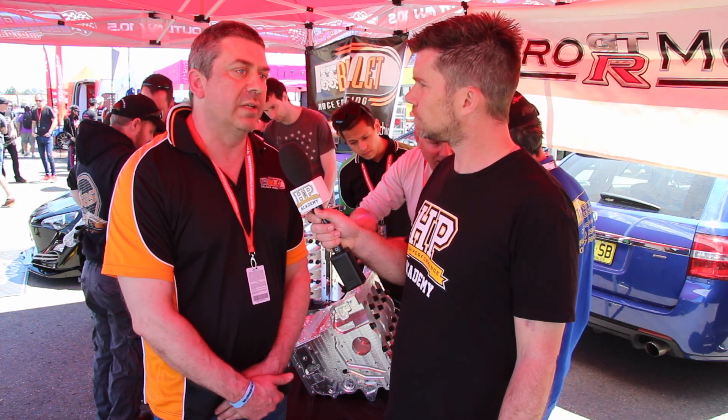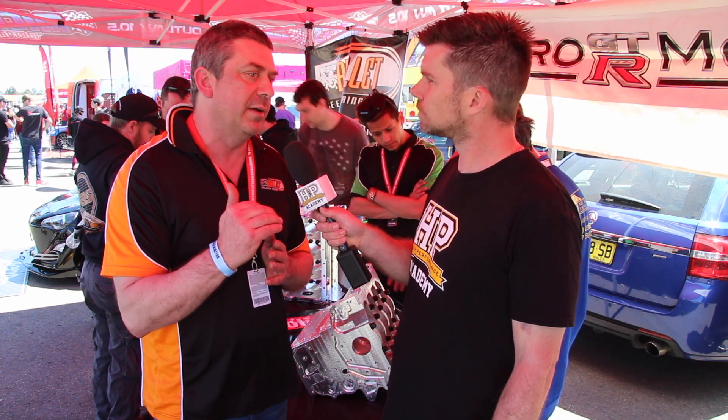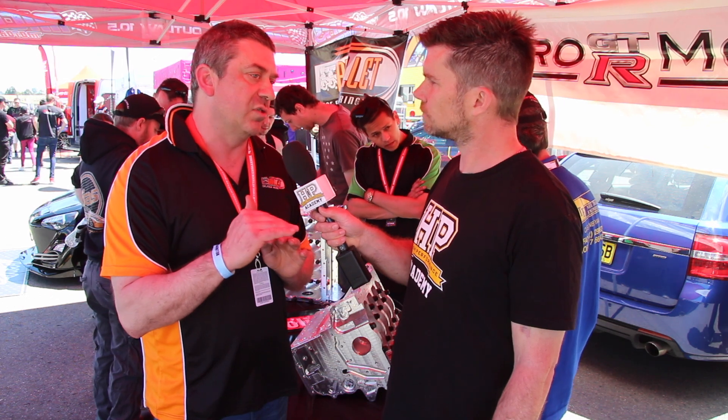This is probably more related to drag applications where we're running on methanol fuel with very short runs, where it's quite common to solid fill the block with grout or a solid filling compound to gain a little bit of strength with no water. You offer the option of running a complete dry deck surface but still retaining water in the block — can you tell me how that works? Some racers have asked for us to do it this way because it allows them to run cooling in the block but without water running through the deck and into the head. They run two separate systems — one in the block and one in the head — and they plug the holes in the cylinder head, and we just machine the block so there are no coolant channels going through the deck. They want to do that because running water in the block may keep it a little bit cooler during the pass and may limit when the detonation point hits.